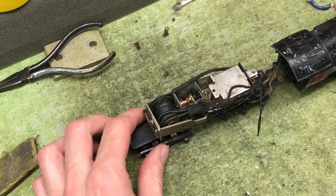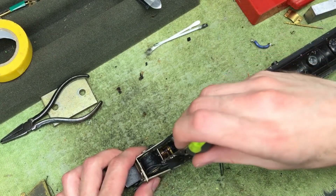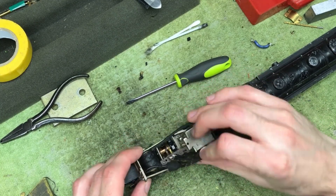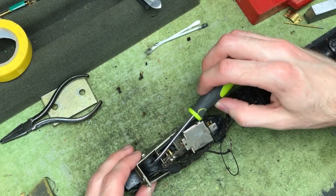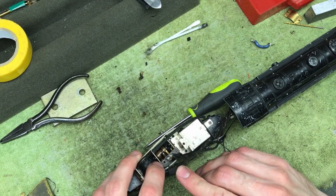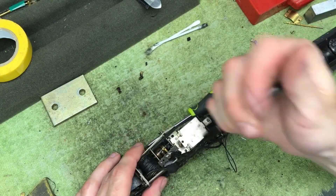I'm going to move the camera a little bit and then get this taken apart. There are two screws that hold this reversing mechanism onto the frame, one here and one there. This is our DC relay on this side, which activates the solenoid over here and that rotates the drum. In order to clean the drum I have to get at it more easily, and I will have to remove this top plate that holds the fingers in place. There are little tiny fingers that contact the drum and it's held on with these metal tabs.